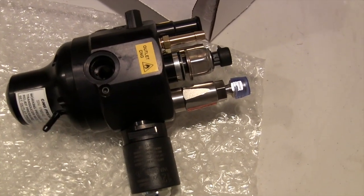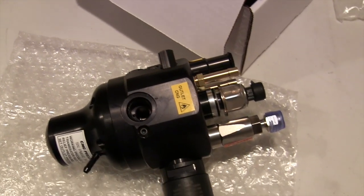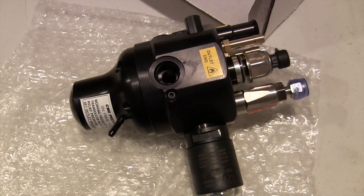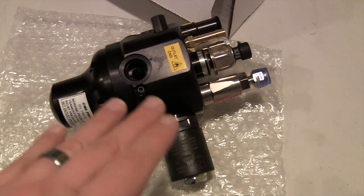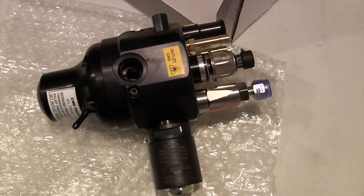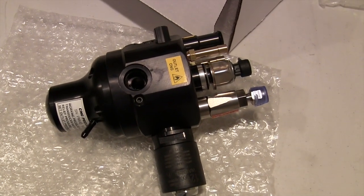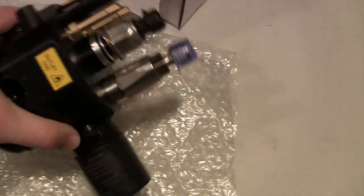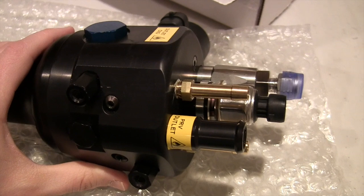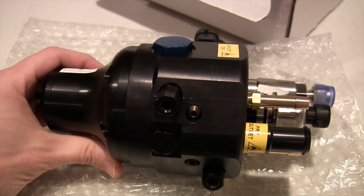You'll get twice the capacity out of this and still be at two bar. A lot of people will say, 'just take our reducer at two bar and crank it up to two and a half, three, or even four bar.' But just like with electricity, even if you increase the voltage that doesn't mean you're going to get more current out of it — so keep that in mind when people are giving you the sales pitch. This is the HD reducer, and it's the reducer you want for any 5.0 liter V8 or above. It can work on anything, but we've found that people converting V8s don't mind spending an extra couple hundred dollars for the best and most reliable reducer on the market. It's maintenance-free — no replacing bladders or gaskets. If you have any questions, give us a call. Go to skycng.com, look up the SkyPro HD kit for more details. We hope to see you there — thanks.